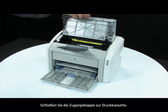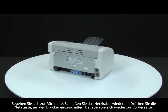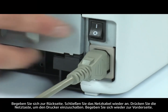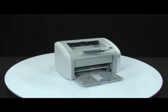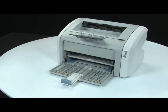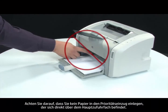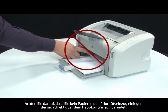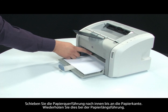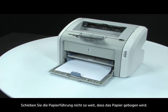Close the print cartridge door. Turn to the back, reconnect the power cord, and press the power switch to turn on the printer. Return to the front and load paper into the input tray until it stops. Make sure you are not loading paper into the priority feed slot, which is above the main tray. The main input tray is labeled as Tray 2 and supports multiple sheets of paper. Slide the paper width guide inward until it stops at the edge of the paper, and repeat for the paper length guide. Do not push the guide in so tightly that it starts to bend the paper.